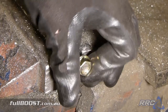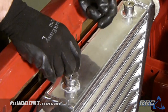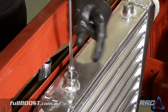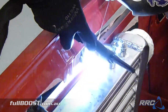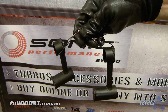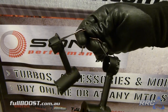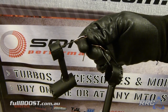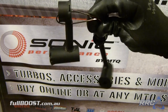Over at the intercooler again — we've got these little mounts we've made up out of round tube and some flat washers. These are the bolts we cut down, and after cleaning up the thread these install with no problems at all. Here are the finished mounts — pretty serious bit of hardware, but it's got to hold onto that intercooler while running down the quarter mile. We'll do something similar on the bottom as well so it's held in by four points — top and bottom — then we'll mount the radiator to the intercooler and tie both pieces in together underneath.